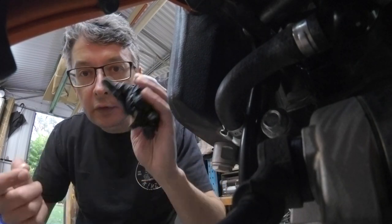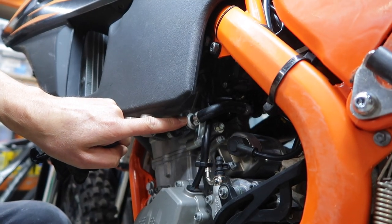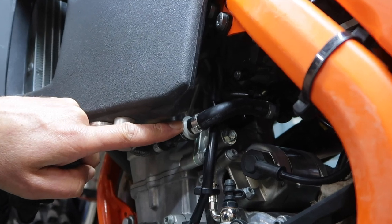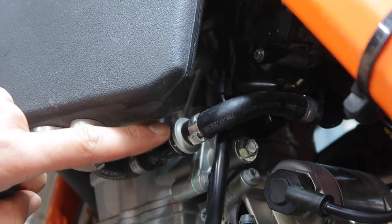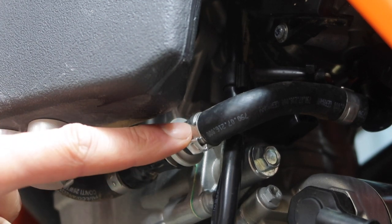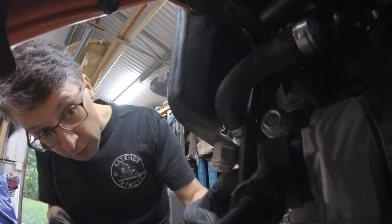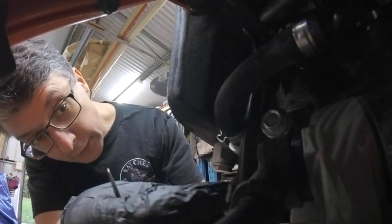Right, let's get into it. It's fuel work, so wear some gloves to protect your hands. This fuel filter is going to go right there — the quick disconnect is in there, the fuel filter will attach to this hose. We're going to remove this clamp and it'll sit just there. First thing I'll do is disconnect that connector.